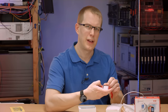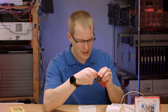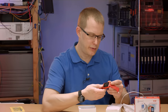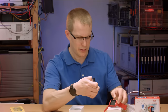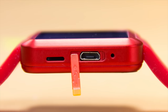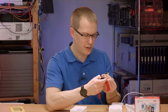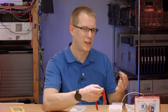After I wear it for a week I'm going to do a complete disassembly, probably breaking it in the process. There's more protective stuff on the back which did not leave sticky residue — fantastic. Unlike the Pebble or the Moto, which have proprietary charging methods — the Moto has inductive charging — this just uses a typical micro USB connector that goes into the side of the watch under a flap. The connector feels rough going in and this cable is obviously very cheap — very thin and flimsy feeling.